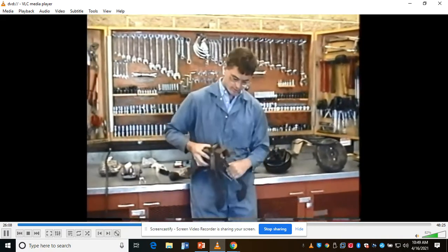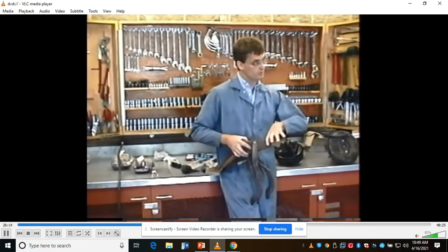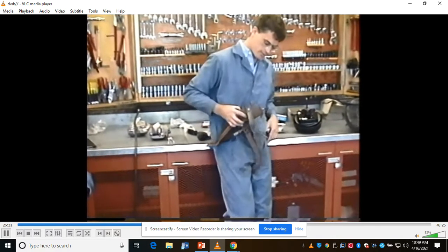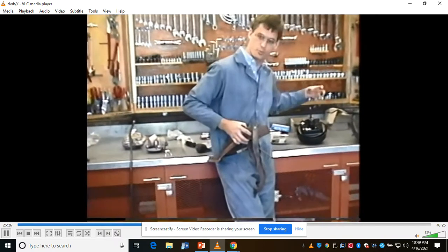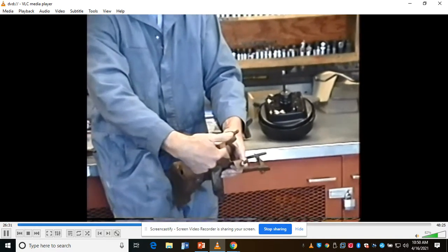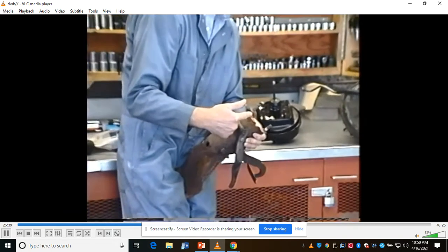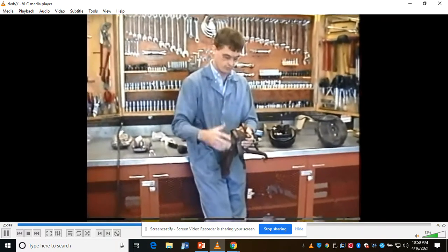The way this bolts in is these two studs here come through the firewall, and the original master cylinder clips right on, and there's two nuts to hold it on. The power brake booster, you'll notice it has three studs, and what you have to do is drive these two studs out, because these are going to come through the firewall, and the nuts are going to go on the back side. But you also notice from the factory, look what they do. There's the third hole right there. I believe it's the best fit. We'll find out when I try it. But I believe that's where the third stud is supposed to come through, and so that'll work.